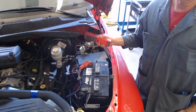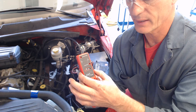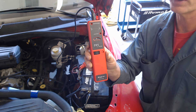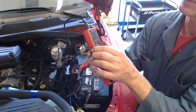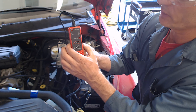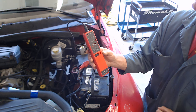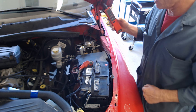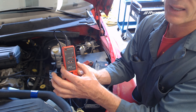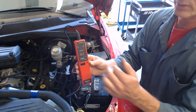I'm going to take the tester and with this thumb wheel on the side right here — that's volts in thousands of volts, so that 10 is 10,000 volts. What we do is go down until this light is solid, then start going up. When the light just begins to flash, that's how much voltage is going through that wire. I'll hold this up, you'll see the light, and I'll start turning it counterclockwise. When it starts to flash, I'll stop — that'll be our reading. Then I'll go to the next cylinder.